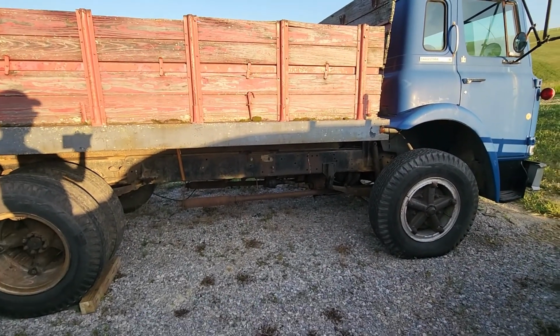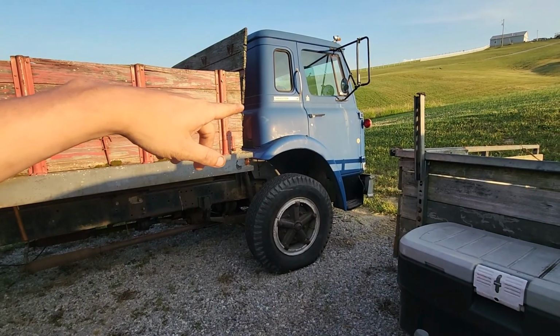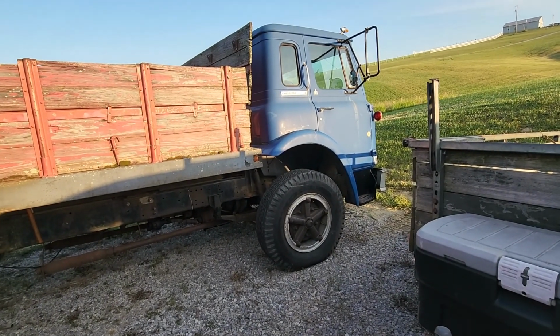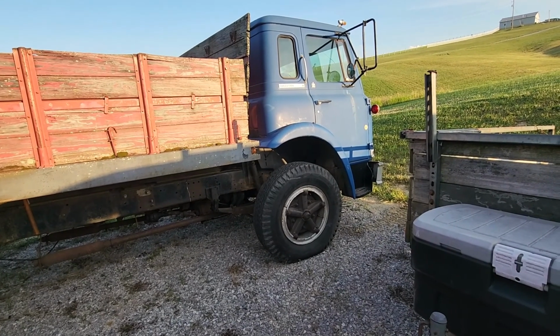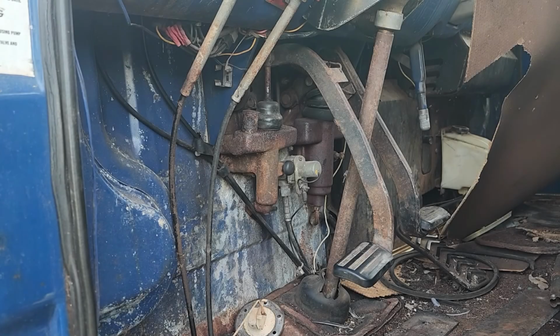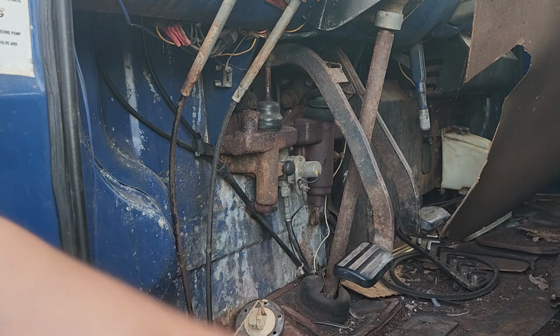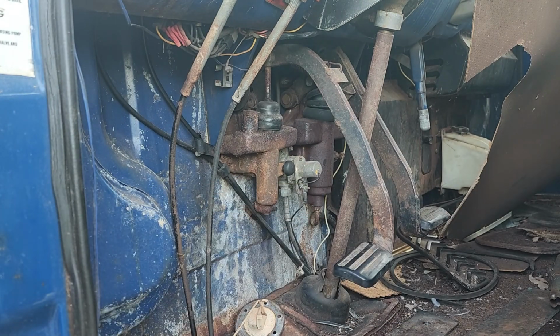So I think next I'm gonna go get some brake fluid and fill both of the reservoirs up there and see if I can't get any kind of a feel in the brakes and the clutch, and we'll go from there. I got you guys set up on the tripod here. I'm gonna try to work around you so you can see what's going on. But I got some DOT 3 brake fluid. Doesn't really matter to me what kind of brake fluid's in here, as long as there's some sort of hydraulic fluid that'll actually work, and DOT 3 is what I have laying around.